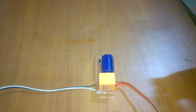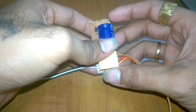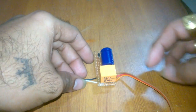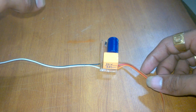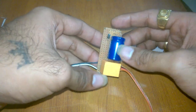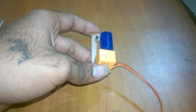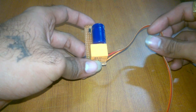The use of the switchback circuit is that when the headlight is on, only the white LEDs will turn on. When you switch on the indicators, the white light will turn off and the amber light will glow. I had to make this on my own because a readymade version was not available online. This circuit can be used in two-wheelers or even in cars as well.